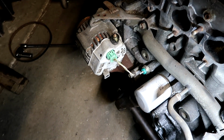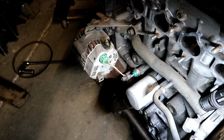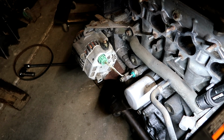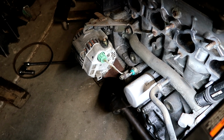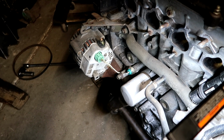I did talk about the alternator. You can use the OBD2 if you buy the jumper, or you can wire it in if you know the wiring diagram, which you can find on Google. Otherwise, if it's an OBD1 harness, it makes it easier if you have an OBD1 alternator. OBD1 and OBD0 are the same, with the rounded plug; OBD2 is square. But at the end of the day, if you know how to wire it, that'll work. So we're going to keep it.